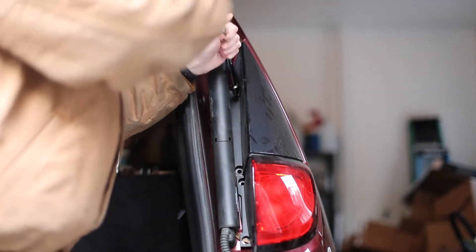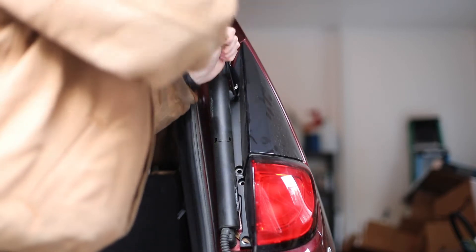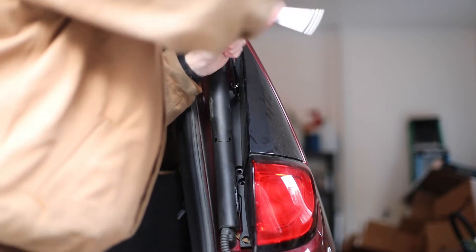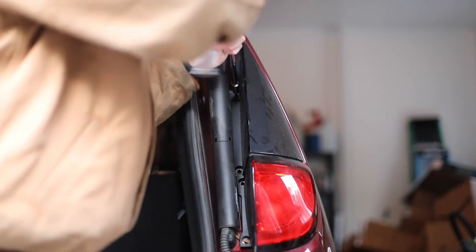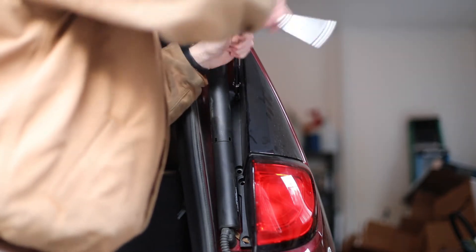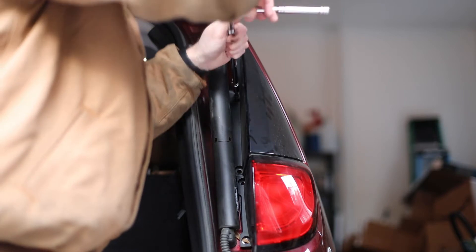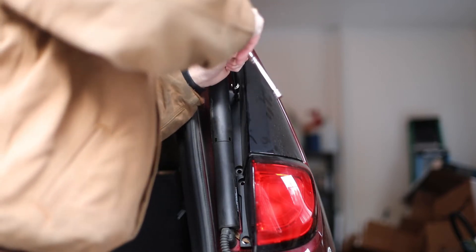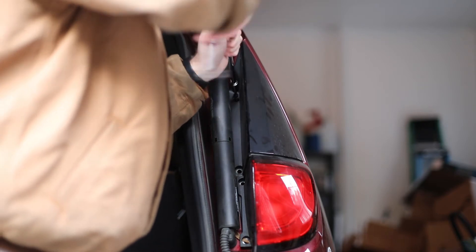You can get better leverage on it and get a good grip on it and get it out easily without breaking it. While you probably could not remove this upper triangular piece and just remove the lower taillight without taking this garnish out, it takes a minute to take it out but it makes it a lot easier — and there's a lot less chance of you breaking this lower taillight assembly if you remove the upper garnish.